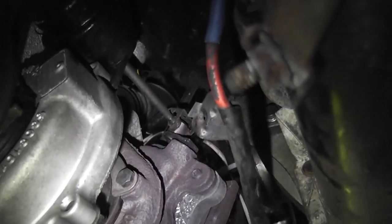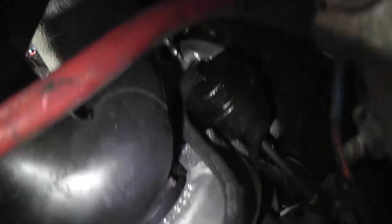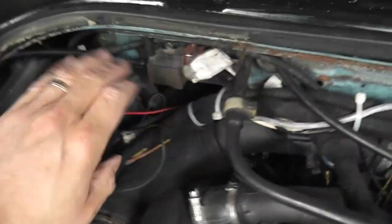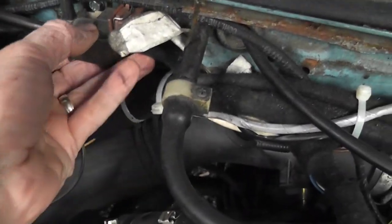That's a good and bad thing, because if it was stuck, that would answer a question and tell us what was actually wrong with the turbo. So let's have a quick look at our hoses — they're all new hoses, there shouldn't be anything broken. That there comes around from the wastegate and goes up to the N75 solenoid, and the N75 solenoid I tested and it was working fine when I tested it. It comes up to this solenoid here, which is on the bulkhead in the van.